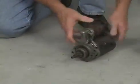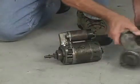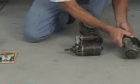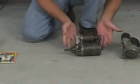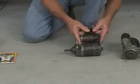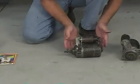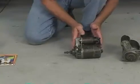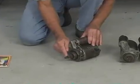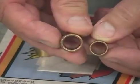Here's another starter you might find on your car — see how much smaller it is than the other starters. You can see how this one is much shorter. You might think, oh, I've got a 6-volt starter on here because it's smaller, but actually this was a starter they used on some of the later Volkswagens. They figured out how to make this starter a little bit smaller and still turn the car over, and it will work fine. This is the one that actually takes the bushing in the transmission.